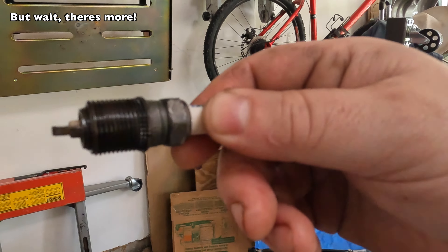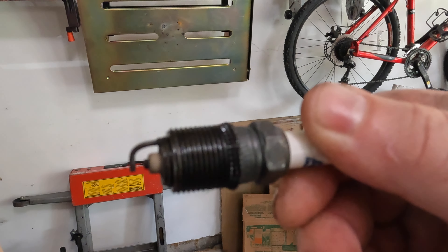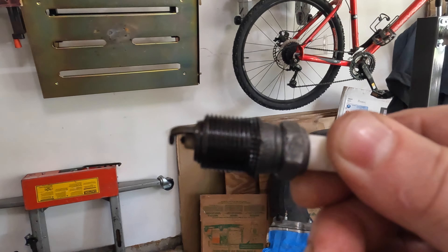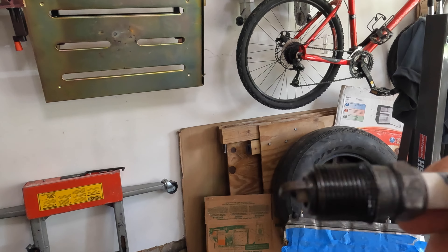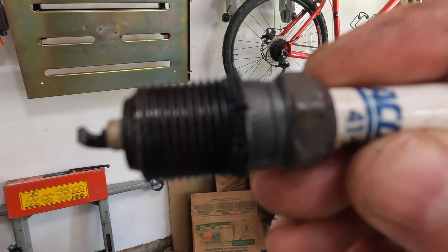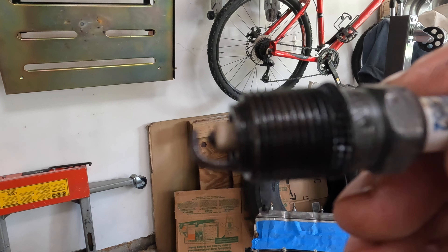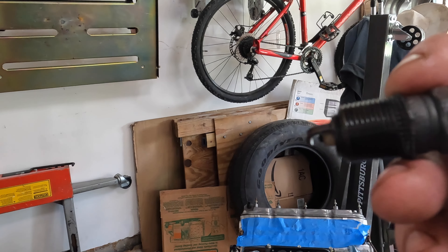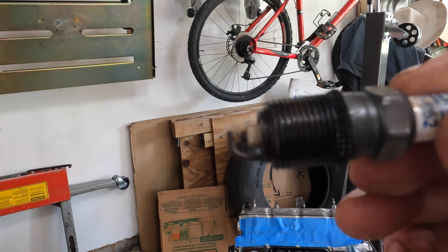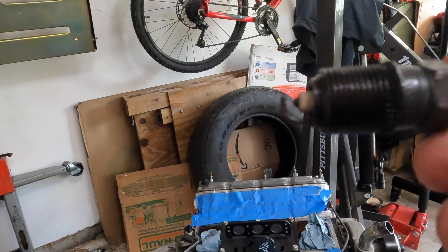Also, I found this yesterday — a spark plug out of cylinder number two. When I was putting the plugs back in, one wasn't going into a hole. I looked and realized somebody had put one of these thread-saver inserts on there but apparently didn't install it properly — there's no RTV gasket as there should be, and I'm assuming where it's cracked at the top they didn't set it properly with the setting pin. The hits just keep on coming with this motor.